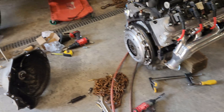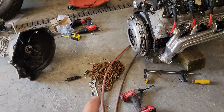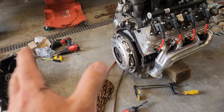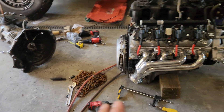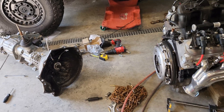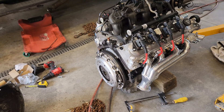I've seen several videos online where everybody's saying you need these exact part numbers. I literally just ordered a random 4.8 clutch and flywheel and it all bolts up and lines up just fine. You don't need a specific part number from a video and pay a bunch extra — I saw one guy show a part number where the flywheel was like two hundred dollars. That's craziness.